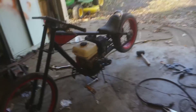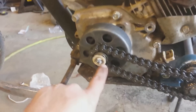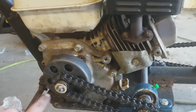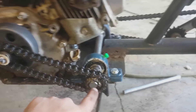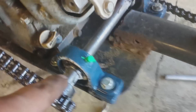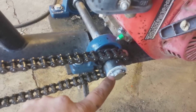I made the jackshaft, made the chains — all that. I welded a little washer on here because this is an old pump motor, and the chemicals pumped through it for farm use will rust up the inside bolt hole. I tack welded the washer there to keep the clutch from sliding off. I ran the chain, put a master link in it, and welded the inside — you can see a couple little tack welds there. I tack welded the jackshaft to the three-quarter block bearing on both sides to keep it from moving side to side, and also tack welded this sprocket hub on here to keep it from walking off.